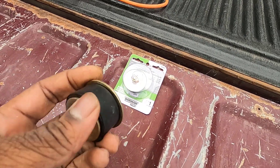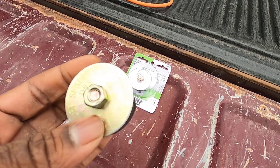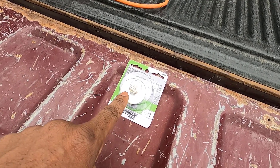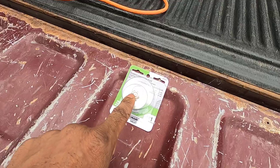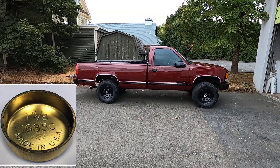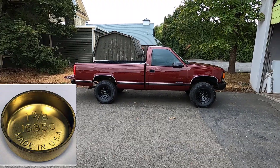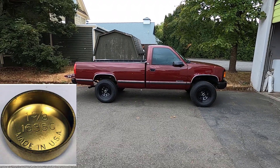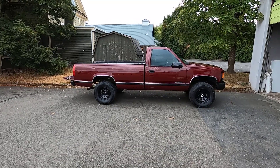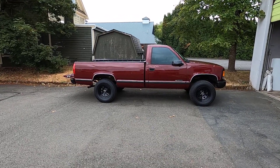Here's another one that I have — this one in my hand is a little bit too big, so I just went and got this smaller one. We're going to use this one today to fix the leaking freeze plug. Normally you would replace the old freeze plug with a new one, preferably made of brass, but in my case I wasn't able to get all the old freeze plug out of the engine block, so the Dorman quick seal rubber expansion plug is my solution.